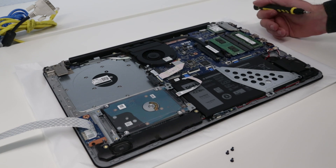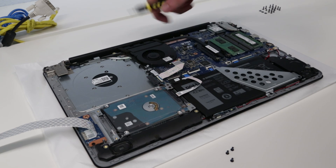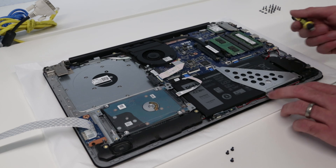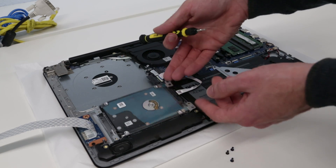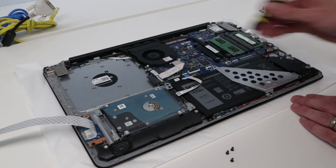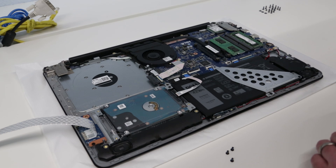If we wanted to remove the CPU cooler, we have one, two, three, four screws there, and then an additional one there which would remove the fan and heat sink as a single unit. And then finally the battery - it looks like you have this bracket here which would need to come off, a screw here, and that one is shared with the hard drive, so it's a case of those four screws, the connector, and then you could remove the battery.